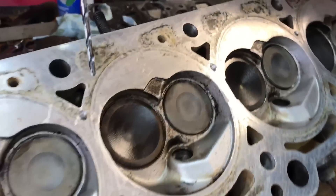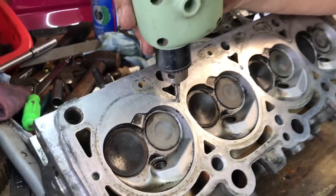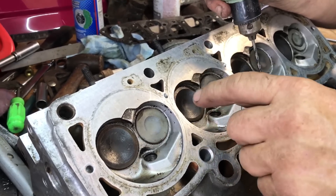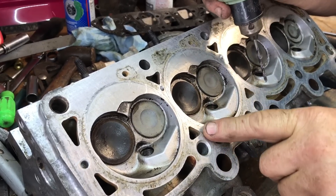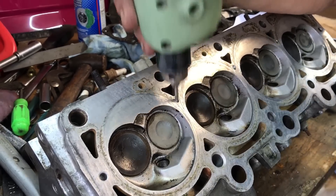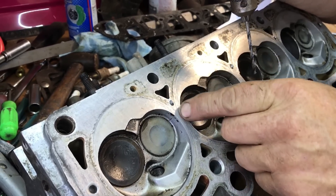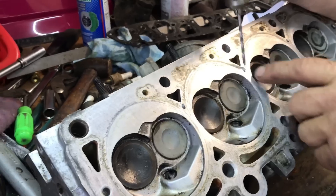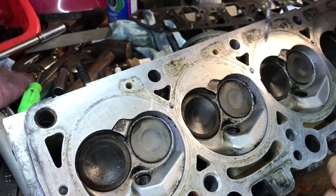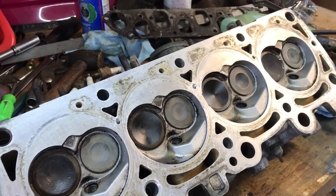You can see there's some modifications done to the cylinder head - holes drilled into the coolant system at precisely this angle. This is called cross drilling - it also matches a hole in the gasket and the block. This was the turbo tube modification, and then Chrysler did it in production. The idea is it cools better between the cylinders. This is an earlier head that didn't have it. It also stops cracks - occasionally you get a crack from this water jacket, and it hits that round hole and stops, spinning the crack in circles so it doesn't go anywhere. It's an easy mod, you just drill it - it's a fairly deep hole though, because there's meat all the way down. After we do this coolant mod, they guaranteed 25 pounds of boost is fine - the head won't warp or crack on pump gas.